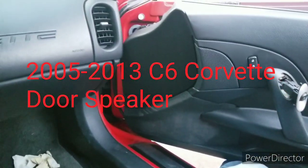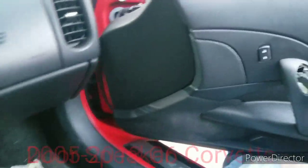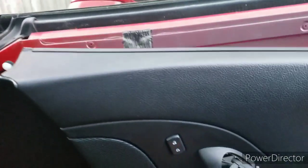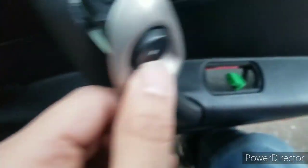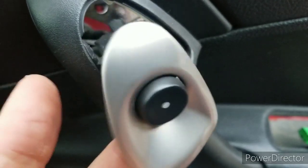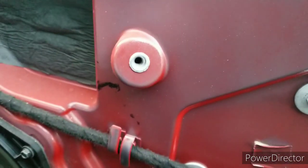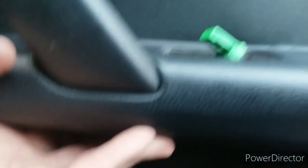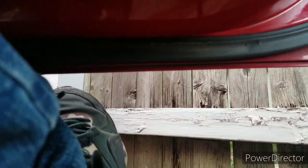In this video I'm going to check on my speaker — it's very distorted and rattling when I have music on. To take this off, see my previous video about taking the window switch off. You pop this out and behind it you'll see a T30 bolt hole, and another T30 underneath the door handle. You unbolt those, and there's a flat spot underneath the door you can feel when reaching under — then you start prying up all the way around the door.